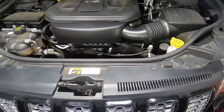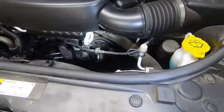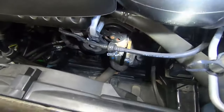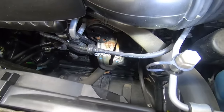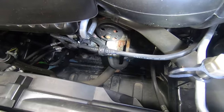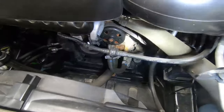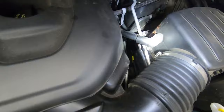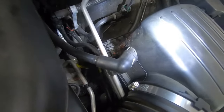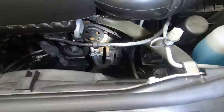We're going to get into the water pump replacement. I'll show you why we're actually replacing it — if you look down there, you can see our water pump, and all that orange is residue from it leaking right out of the weep hole. It's leaking so bad that when it's warmed up it'll drip onto the pulley and fling coolant onto this line and onto the air intake box.